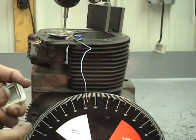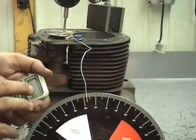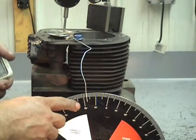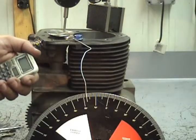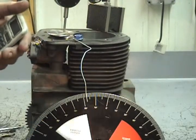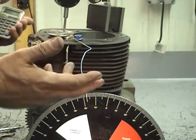If you wanted to degree the camshaft in on the exhaust side, it works the same way but in reverse. Take 280 divided by 2 equals 140, minus the 112 lobe center — so 28 degrees would be the closing point and this was at 30. The reason it's at 30 instead of 28 is because we advanced the camshaft on the intake side, which actually delays the opening on the exhaust side. Every degree you move the cam is a 2-degree split — 1 degree of advance on intake equals 1 degree effect on exhaust. So every degree is actually a 2-degree move in the total camshaft. The cam's in 2 degrees advance.